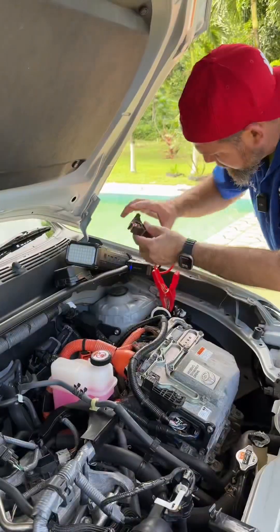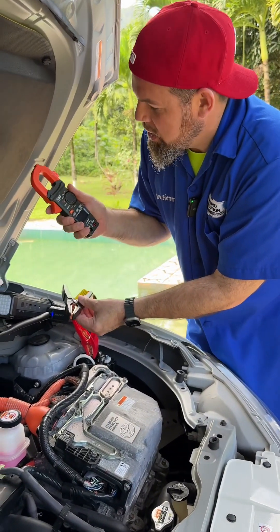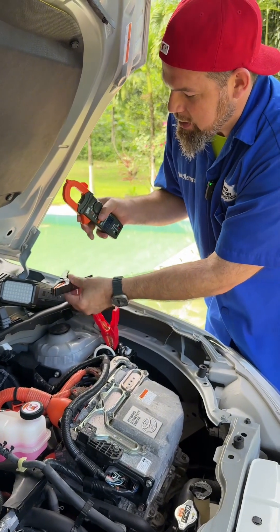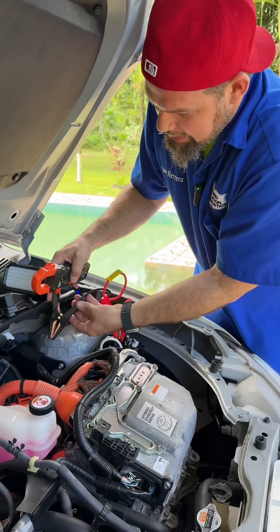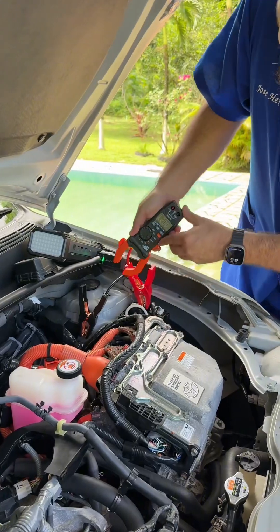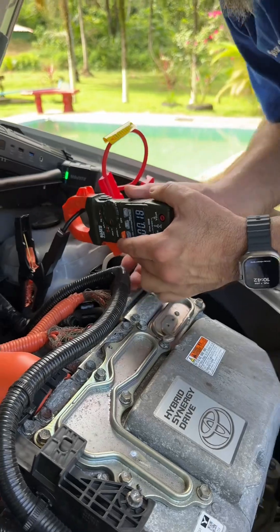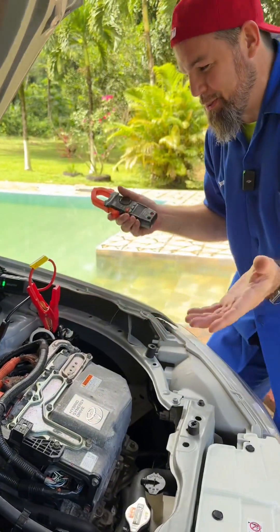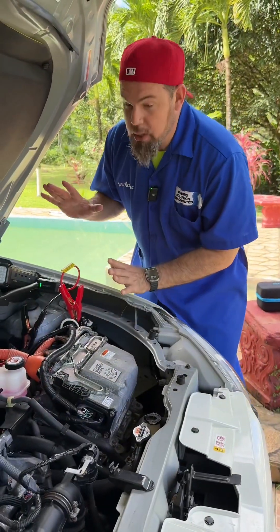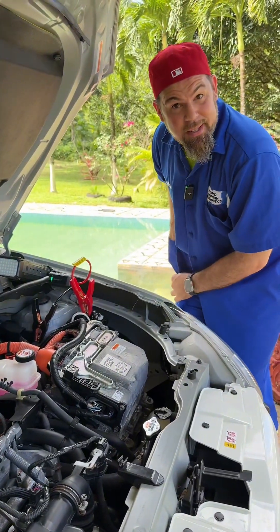We're fully connected. But before doing that, I want to make sure — if by chance the battery is discharged, we're going to see most likely a potential difference, and therefore there's going to be current flow. Let's see if that is true. Connect it right here to chassis ground. Let's see if we have current flow. Well, the current flow is actually tiny. This means that I already jump-started my vehicle, so the battery is fully charged. The difference is practically none.